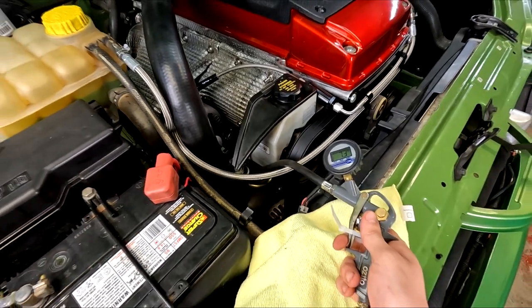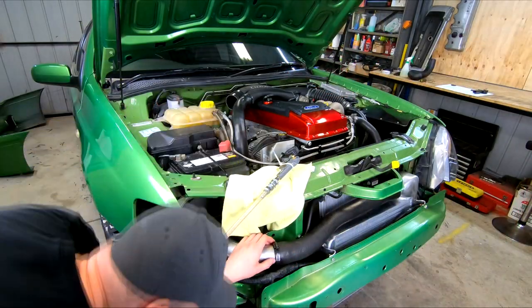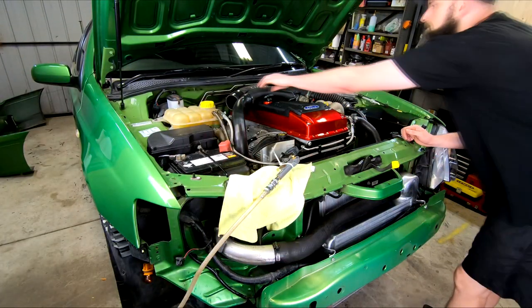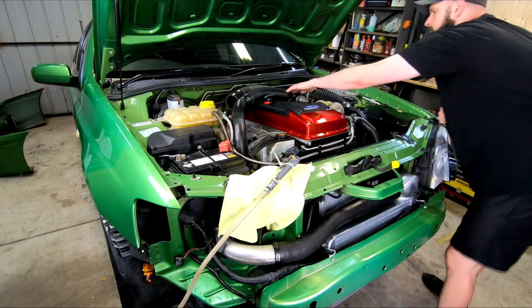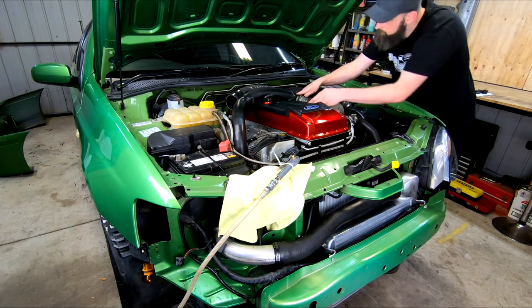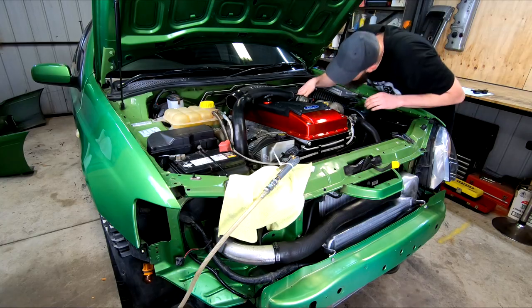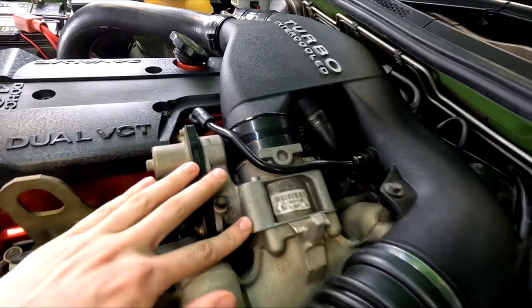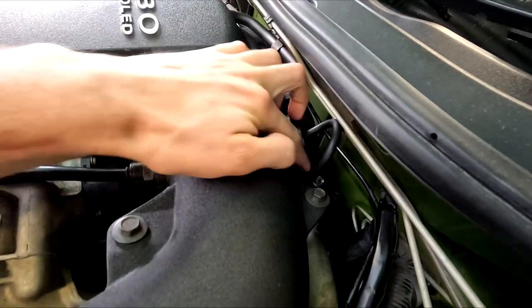looking for leaks. With some pressure now added, we can listen for those. We may have a small amount of compressor and other air noises that we've talked about already, but a small leak may sound more like a whistle or hissing with a higher pitch. You're looking for leaks anywhere in the intake system, from the obvious cooler piping joins to all sorts of things like throttle body to intake and intake to cylinder head, any MAP sensors and vacuum lines, turbo compressor housings, blow-off valves, etc.